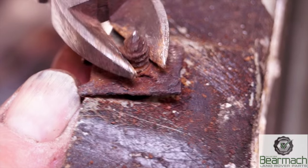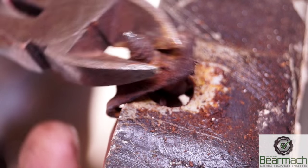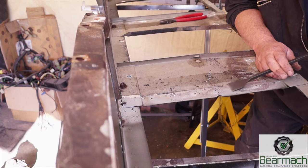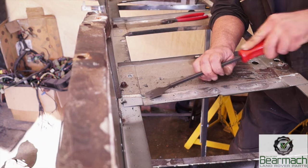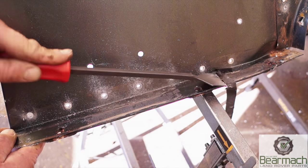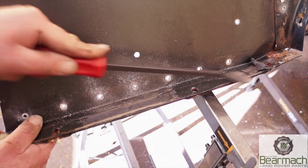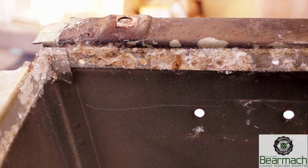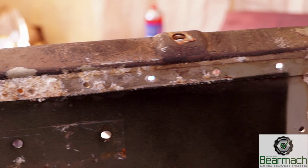These screws and fittings are easy enough to remove — you can unscrew them from underneath or just bend them over and pull the whole clip out. There's plenty of sealant on the seat box which needs to be removed. The underside generally doesn't need to be painted, however we need to clean this up before we reassemble it. The sealant that Land Rover used to seal the floor to the seat box is a type of tape which never goes really hard — this can be scraped off and the remainder wiped off with some standard thinners.